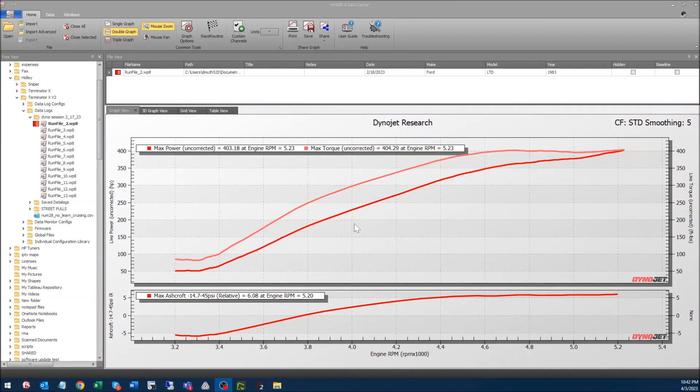I don't really have great video — I was mostly just busy hitting buttons on the keyboard to make this car work. I'll show you the progression of dyno hits and ultimately what power I ended up on. This first hit was a very simple one — a quick hit on the wastegate, just let off at about 5200 RPM to make sure the straps are good, we have a decent tach reading, and the car doesn't fly off. About five PSI the whole way, so I was feeling pretty good that the boost control was working.